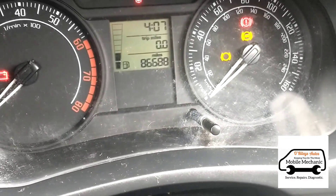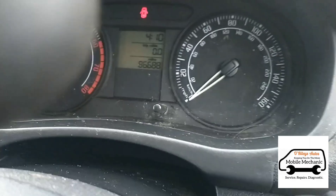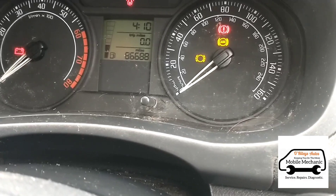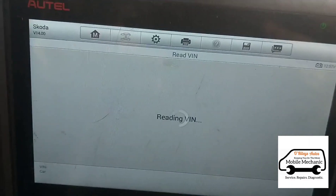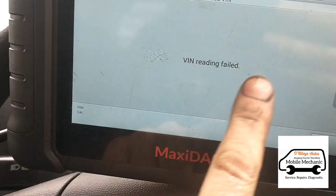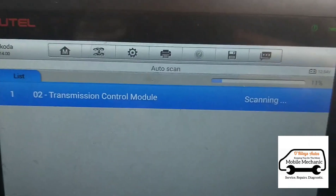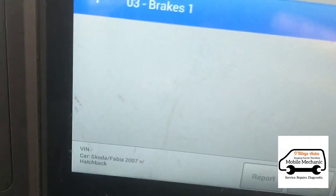The key is flashing so we've got a second key to try. Now the key light's not blinking with the second key, but it's still not starting. Running a scan - the relay wouldn't show up anyway. It's failing to read the VIN number and it's not finding the ECU. I've manually typed in what ECU it's got and we're trying to scan through the manual settings, but we're still not getting any numbers or anything coming up.